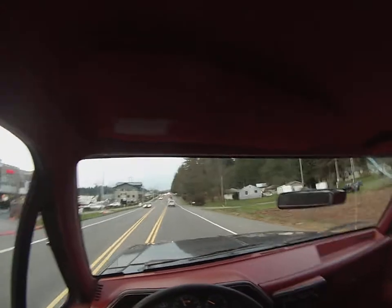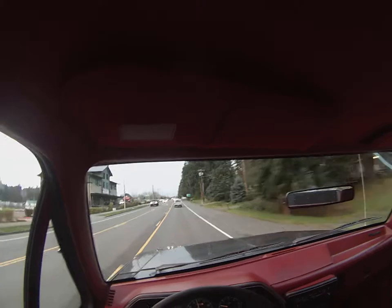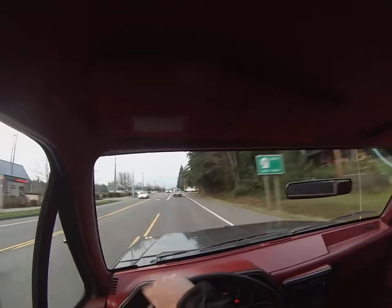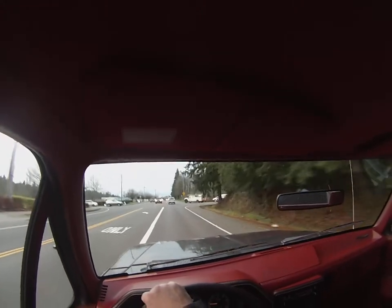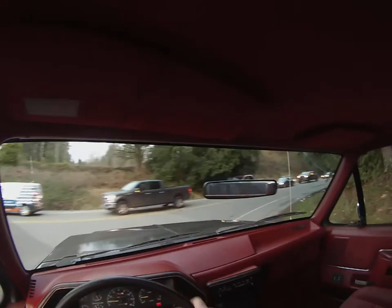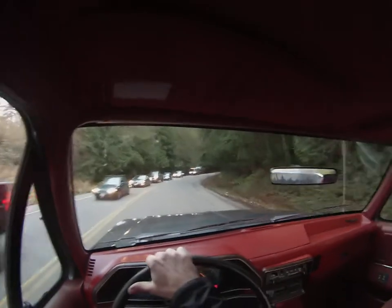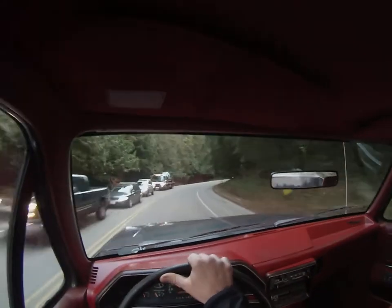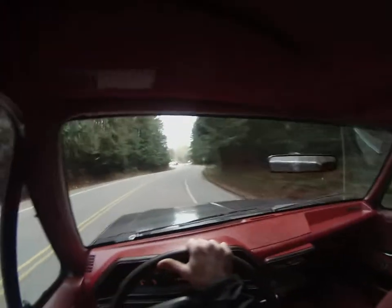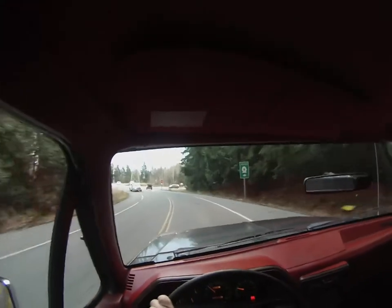So it's had the tune-up done, you know, air filter, oil filter. Also, when we did get the truck, the front fuel pump and sending unit was not working, and the fuel smelled old. So I actually had both tanks pulled, new fuel pump and sending unit in both tanks, and the front tank we just had replaced because, I mean, these trucks are really affordable to get replacement parts for, but it had old gas in there for a long time and it didn't look very good. And for $100, brand new tank, that was just the way to go. And so we just tossed the old one.